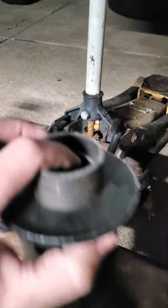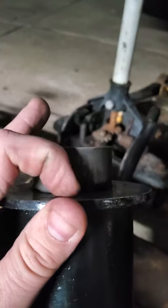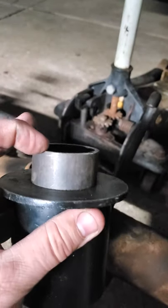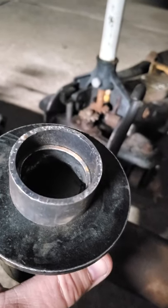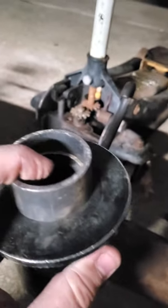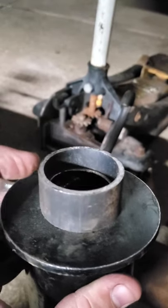But this is a little step five that I've done. I cut this original inside piece short because I wanted it flush with the top of the coil. But what I forgot about was the rubber grommet that's about a quarter of an inch thick, and then the spring sitting on top of that. So this is now one inch of pipe - from here to here is roughly one inch, maybe three quarter. I went to a metal supermarket and they were happy to help me. I told them what I was doing - they wanted to see the car when I was done. This slides over the top, and it's also extremely convenient. Even if I hadn't cut this inside short and I didn't have the Airlift 1000 airbags on the inside - that's why I cut them short - I didn't want this to rub a hole in the bottom of the bag.